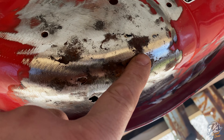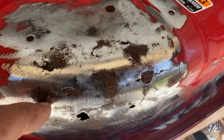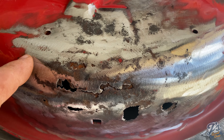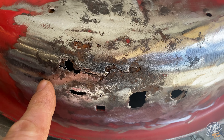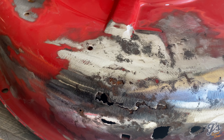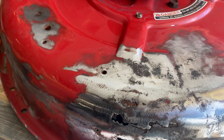We'll probably end up cutting some of this out and patching a new piece in. I don't know if I'll patch right over it - probably better to cut it out. We'll get the new piece fitted and see. Everything else was pretty much just stuff that needs to be painted. The front and rear edges are pretty clean. I've got a finger air sander that was just perfect to get into those areas. We're going to start cutting up some metal and working on the first patch.